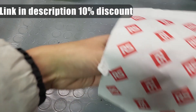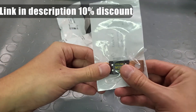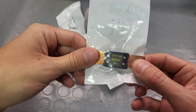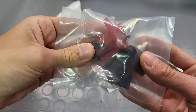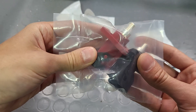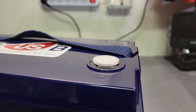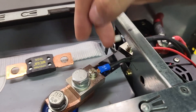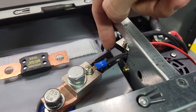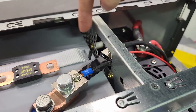A parcel from RS Components has also arrived. Given the high currents in this project, I decided on quality components like these 100 amp fuses. Here are the connectors for extending the battery — rated for 200 amps and 1500 volts from Amphenol, so they are absolute beasts. Since the external batteries will be connected with additional cables, adding 100 amp fuses is a must. I also removed the electrical tape and printed a bracket to hold the shunt securely so it doesn't touch the frame.